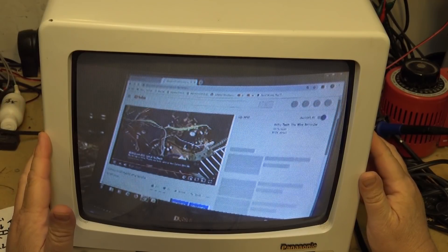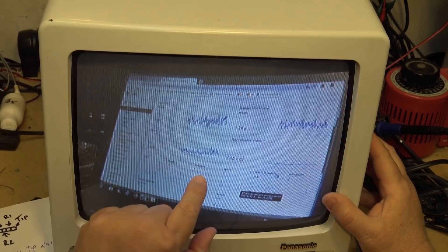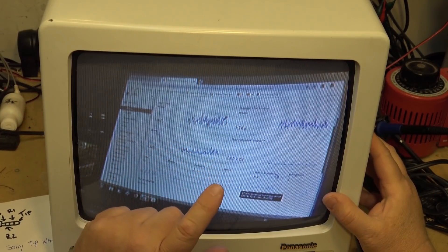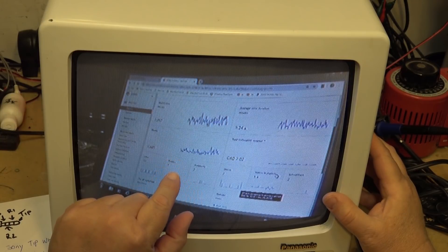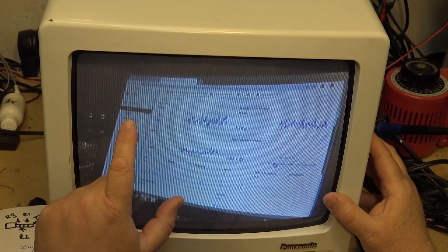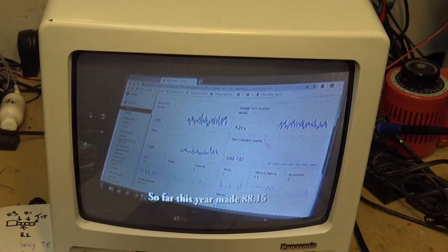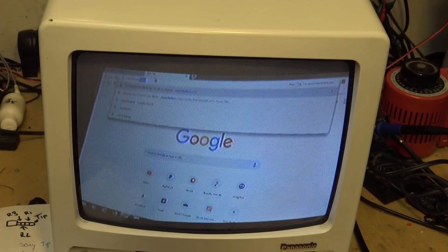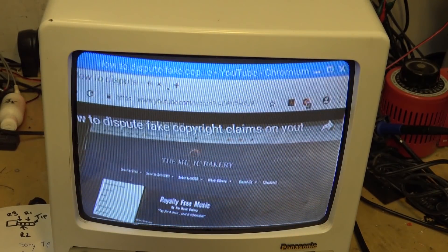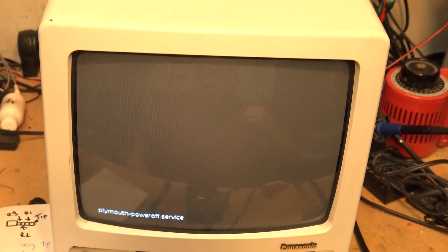To recap: you turn on the power — you won't see anything on the screen unless you have an HDMI monitor. If you have HDMI, you can wait for it to say hold the shift key to go into recovery mode. If you don't have an HDMI monitor, wait about 15 seconds, then hit the shift key, hold it for a few seconds, and release it. Give it a chance to load a sub-menu you won't see, then press the appropriate key: 1 selects HDMI normal mode, 2 selects HDMI safe mode, 3 selects PAL, and 4 selects NTSC.